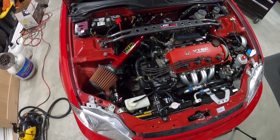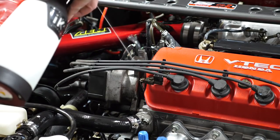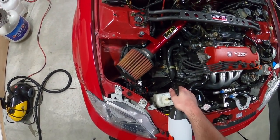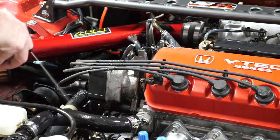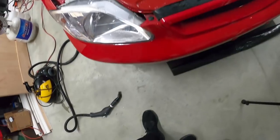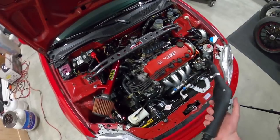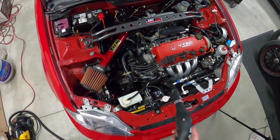What I'm going to do down by the distributor is spray a little bit more all-purpose cleaner, just in the areas that I kind of missed. This is one of those places where you don't want to soak, because the distributors on old Civics do not like to get super wet. Using steam should be fine because it's kind of like dry cleaning - it doesn't get super wet. So I'm going to spray everything down here, take my brush, and use my steamer. I also laid a capture mat under the car for anything that's going to continue to drip that might stain my concrete.